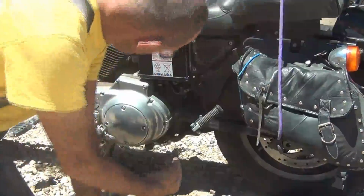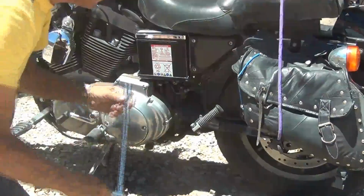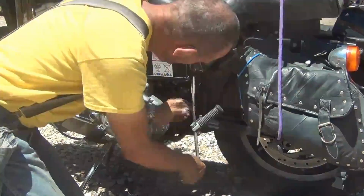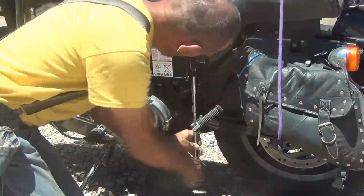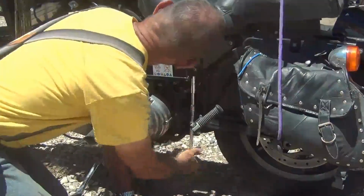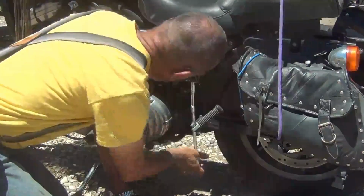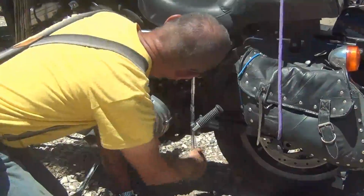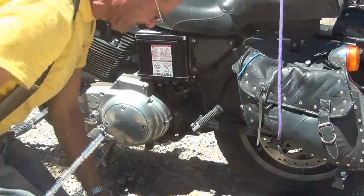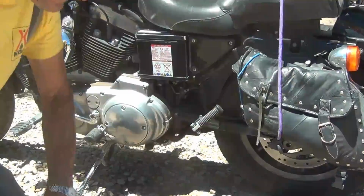So this nut is screwing on a bolt like that, so we don't want to get them loose and falling off. With a lock nut, that pretty well guarantees that's not going to happen. And you shouldn't use a lock nut more than 4 or 5 times. So, that was time I had a new one anyway. I lost that one yesterday. It's got to be right around here somewhere, but it's just fine because it's been used 4 or 5 times. And the Teflon kind of doesn't work real good after that.